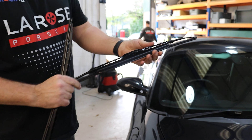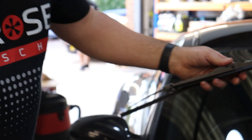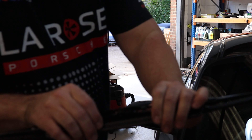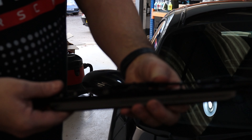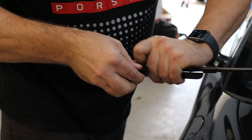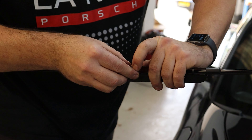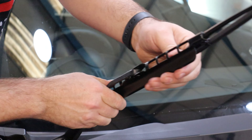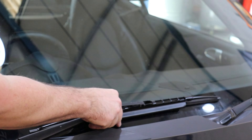The spoiler is going to go on the driver's side, facing down. Because these blades are made for German cars, they're set up for left-hand drive vehicles. So what you have to do is pop the clip out, flip it over, pop it down, then pop it up into the clicks and pop it down.